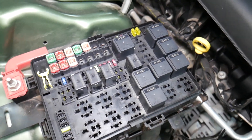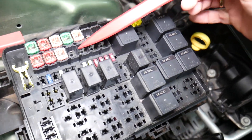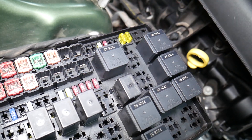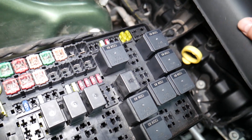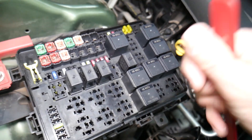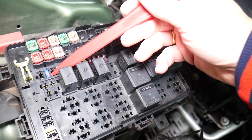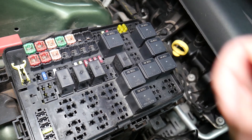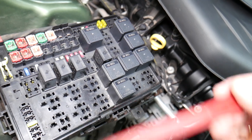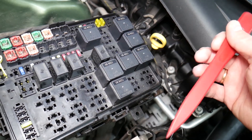It is super important to always test fuses and relays. A common mistake people make is thinking a fuse is good when you cannot clearly see if it's burned. In that case, you may end up spending money and time on parts you don't need. All you have to do is test the fuse - we'll put a link in the description below on how to test fuses. It takes only a few seconds to find out for sure if it's good or bad. The same thing applies to relays, which can be really expensive.